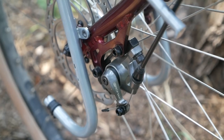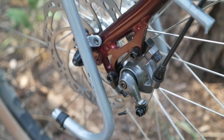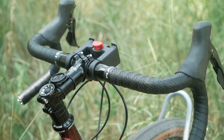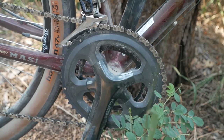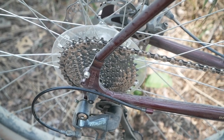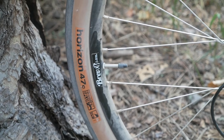There are a bunch of modern touches. The bike has disc brakes, although they're quick release and not through axle. That might be a deal breaker for some, but for me it's not. In terms of drivetrain, it uses Shimano Tiagra brifters, a Tiagra compact road double, Tiagra rear derailleur, and a rear cassette which is only an 11-32. The bike ships with tubeless ready rims and a pretty ubiquitous WTB Horizons, which are nice and big and supple.